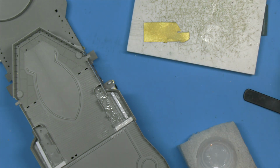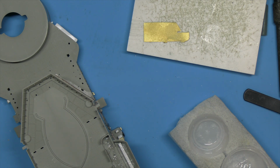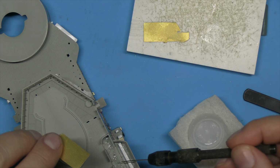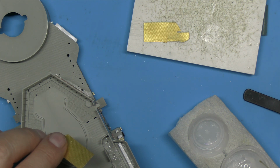If we were installing the full steel deck that we've taken the cut out of, then annealing it's a good way to go to make sure it stays down. But in this instance, I want the strength, so annealing it wasn't really an option. We'll put a little bit more adhesive down just on this edge here. We don't want anything still springing up really.